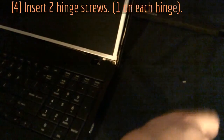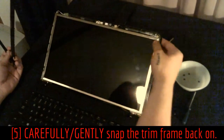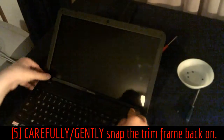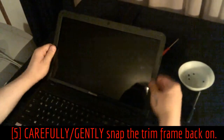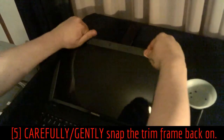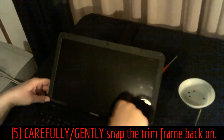In there are two gold-plated threaded holes, one on each side — that's what you want to get your screws into when you put it back together. Line them up there. I've got these two screws in, everything is nicely aligned. Now put the front bezel back on — first click it into the hinge holes, then just like before, gently go around and snap it back in. Feel it out, work your way around. Don't force anything because you can easily crack the screen. Make sure it's in there all the way around.